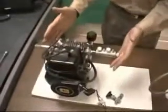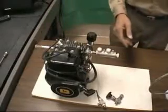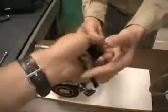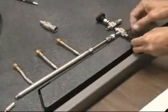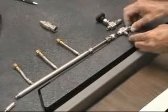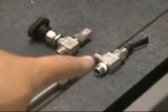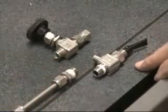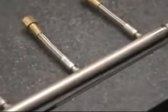Here are the essential components: you make the decision on how you're going to operate the fuel storage, delivery, and metering of the fuel — more or less like we do on this one-cylinder. So this mechanism right here would control the flow to all eight, all six, all four, all three, or just one cylinder. You can make this so that it's manifolded for a hand valve, or manifolded for a combination foot-feed-operated flow valve, giving the ability to do everything your automobile does today off of a single control for high-speed operation and a single control for idle. It is exactly this valve that's in the Geo outside that we were driving around in — that simple.